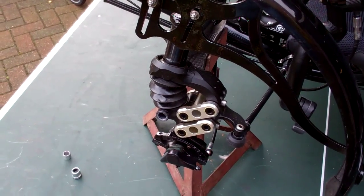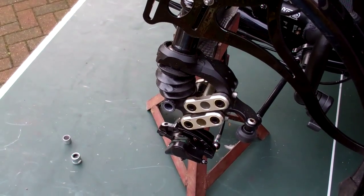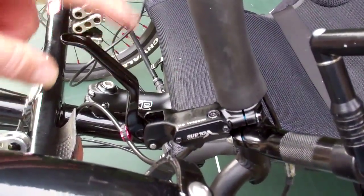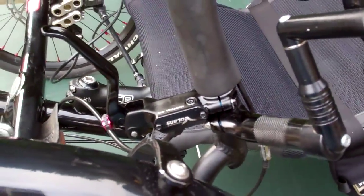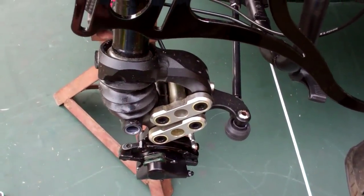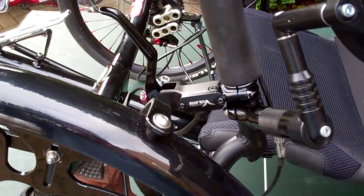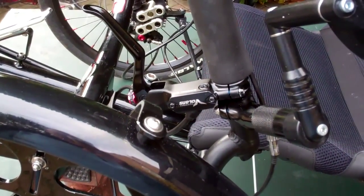It's a nice morning. I've been having a little bit of problems with this left hand brake. I managed to make up a little jig and laid the lever flat so I could take the top of the reservoir off, topped it up, and pumped it with the calipers forced open and burped it as recommended. I did that for five minutes, topped the reservoir back up, put the cap back in, and it's made a hell of a difference.